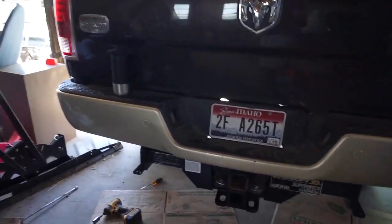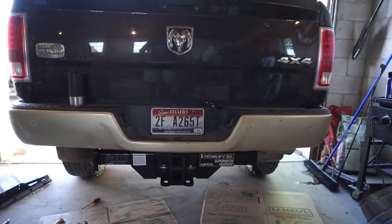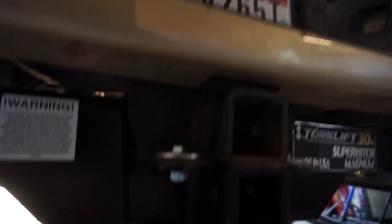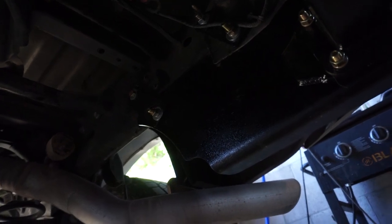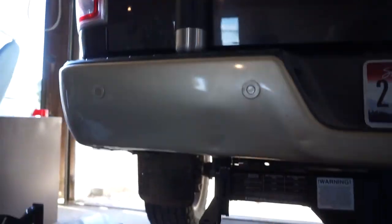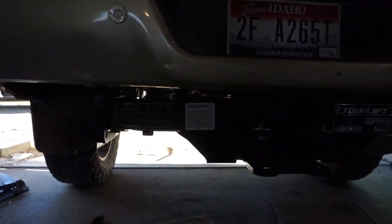This is the first part of our Torque Lift camper series. There's the hitch installed in the truck — I am so excited to use this and how much safer it's going to be. We went in and torqued everything down to spec. I'll let your book refer to the specs on torque you should torque these to. I just need to put the heat shield back in and put the spare tire back in, and then we're all done under here. We're going to go ahead and install the camper brackets.